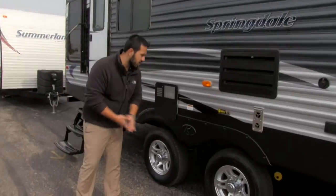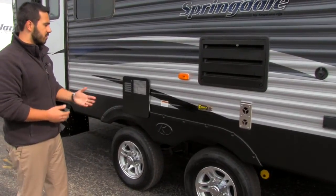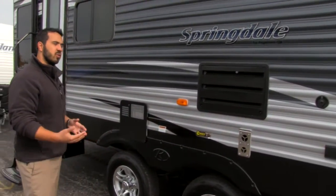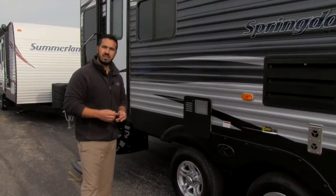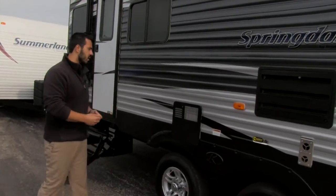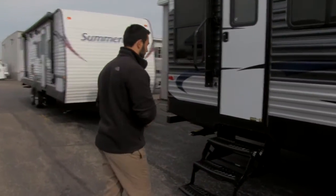As we move back, we'll take a look at our axle system. You'll notice this is going to be spread axles, which gives you better tow ability. It will also have the correct track alignment system — it's been proven over time that axles can get misaligned. The correct track system makes it nice and easy to realign them so you're not getting uneven tire wear.